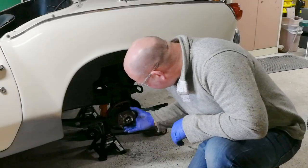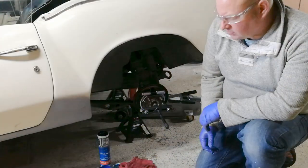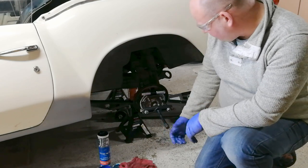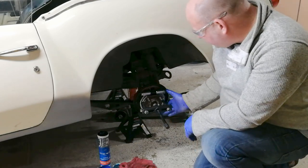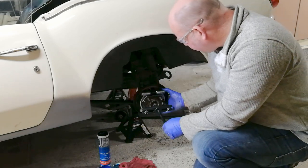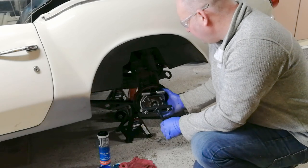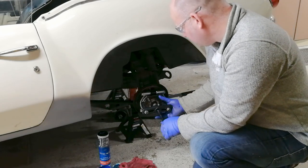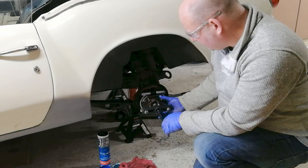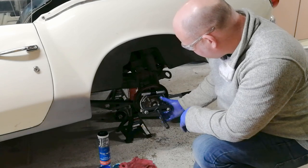Right, that's the brake fully disassembled now. I've now mounted the bearing puller on the flange back-to-front, because I want to put an even pressure across the plate to try and pull it off without spinning anything. I've got it just touching the actual surface behind the plate, clamping down on the back of it. So I'm going to get my impact driver and see what happens.